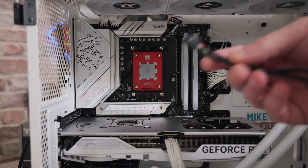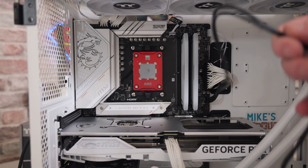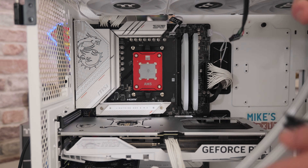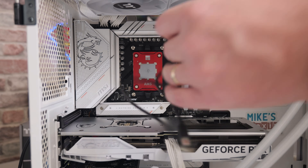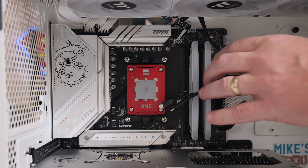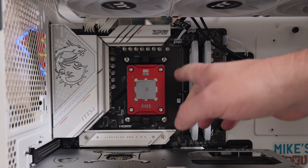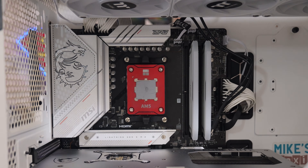Something else we're going to do now is take our USB connection — it goes at the bottom of the motherboard, but because the connection goes into the top of the pump head through one of the two USB connections, I'm actually going to pre-route this through the top here and pull off the majority of the excess, leaving that to the side until we're ready to connect it up. Sometimes once you've got the pump head installed, there may not be a great amount of clearance in the top section, so it's nice to get the cables put through now to make life a little bit easier for the installation going forward.